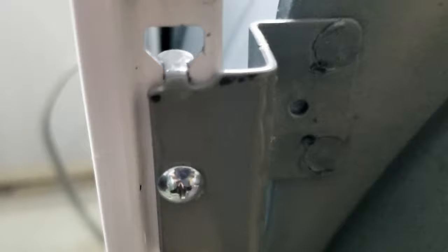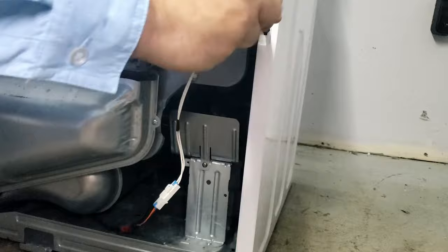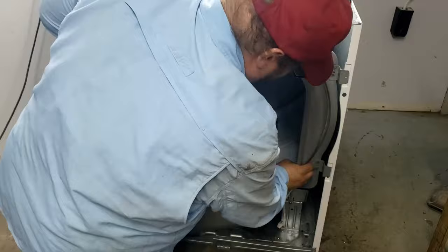Put the bulkhead back on the unit and make sure the tabs of the bulkhead go on properly before beginning to put the screws back on, because sometimes the casing on this type can shift. Also don't forget to install the moisture sensor harness while putting the six screws back into the bulkhead. Getting the bulkhead to fit on just right may take a few adjustments between the tabs and screws.